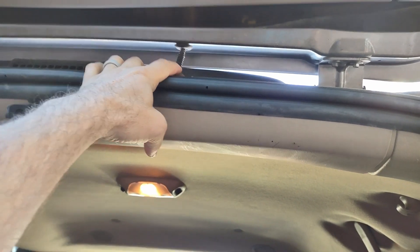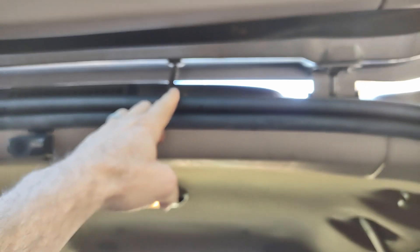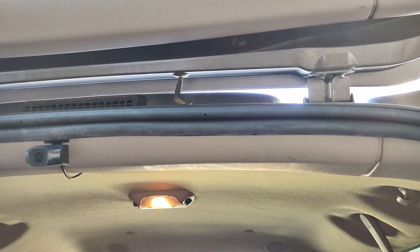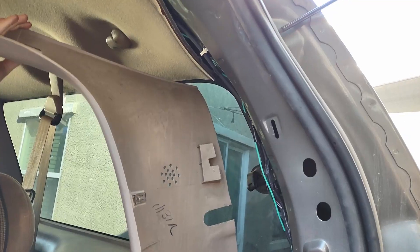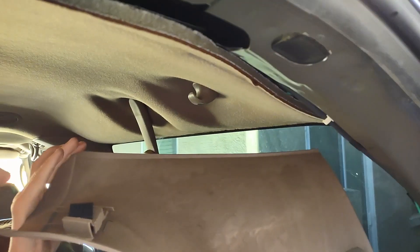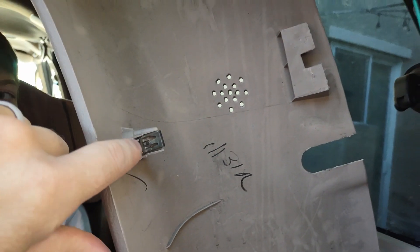This right here is the wiring for the third brake light high-mount. We're going to access that wiring and run a feed to each of the corners. Take this panel down — it comes down pretty easy, these little clips pull straight down — and then we'll need to access the wiring up here. To remove this side panel, there's just a little piece of velcro right here.